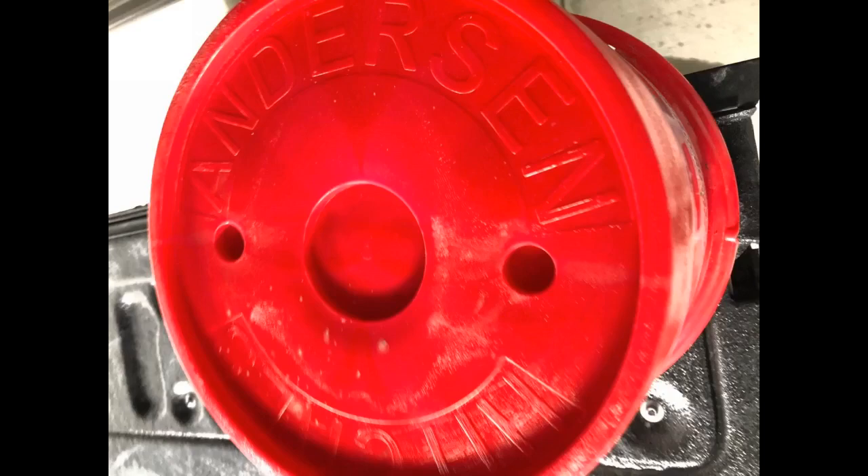I bought 6 for our 5th wheel — I have 6 hydraulic jacks. They stack to store, take less space than wood, and are lighter than wood. They give around 8 inches of height, so the jack pistons don't have to extend as far, making the trailer more stable.